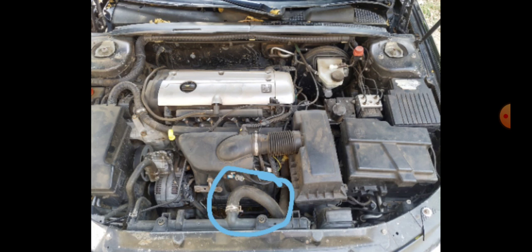If your engine is overheating and you touch both of those bigger hoses and both of them are hot, do not touch your thermostat. Forget about it — leave your thermostat alone. Whatever is causing the overheating has nothing to do with the thermostat in that case.